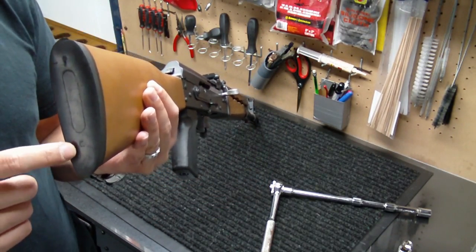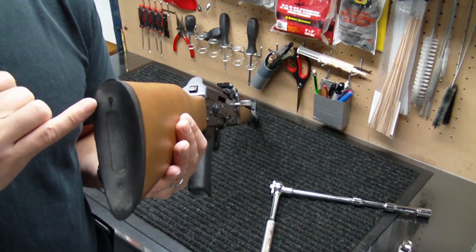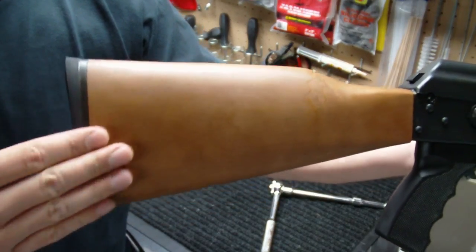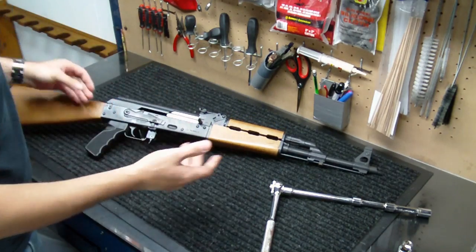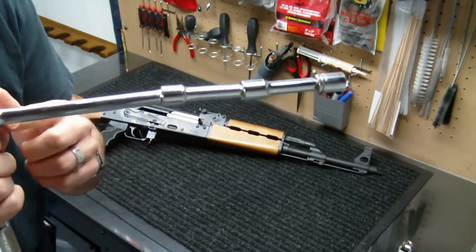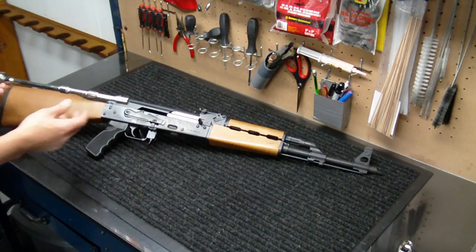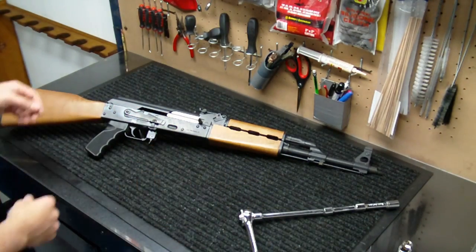The back of the pad here has two screws — one right here and one up here where it already looks like somebody stuck something in there. What we're going to use is a flathead screwdriver to pop our way in, and then it should be a Phillips head screw. That should allow us to take off this rear pad and give us access to the stock, where there should be a hole to get into the bolt. The bolt, from what I've read online — and there isn't a tutorial out there online as far as I know that shows this process — should be 13 millimeters. I'm going to use a socket wrench with one large extension and then two smaller extensions. If you don't have that, it might give you an issue — you need just enough distance to get it done.